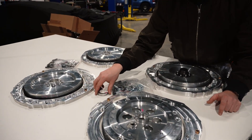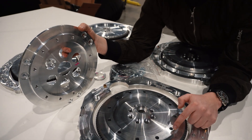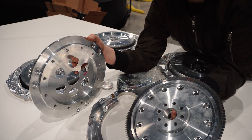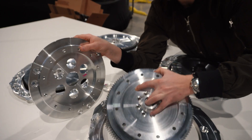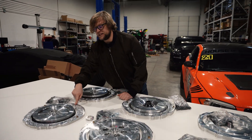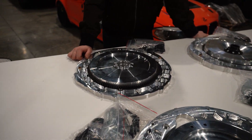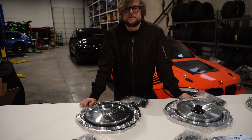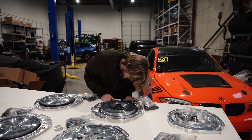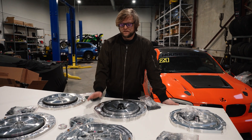Some kits are like this one, where you have a converter adapter that bolts to the converter. You bolt this flywheel to the adapter from the back side of the flywheel to these holes right here. Depending on the engine combination — this is a 1JZ adapter — you'll have slightly different variations. This is a 1UZ adapter. This is an M50 to 8HP70 adapter — very cool setup. So if you have a turbo E36 or E46 and you want to run a big transmission behind it, you got it there. And this is a K-Series adapter, so if you have a Honda K-Series and you're trying to run an 8HP70 from a Challenger or Charger, you have your adapter here.